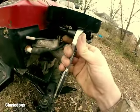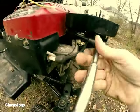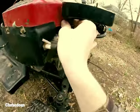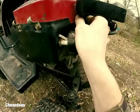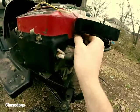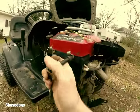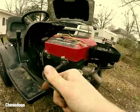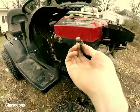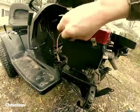Up in here is kind of going to be a tight spot, so what I'm using is a 3/8ths extension. I'm just going to break that loose right there. I'm hoping that this motor isn't completely shot — I believe the starter is just the only problem. I'll just have to see once we replace it. Hopefully that's the only issue. This motor looks like a pretty good running motor. I've never fired it up — I had it on an old lawn mower before and I just got this mower a couple of days ago.